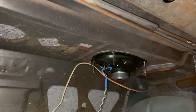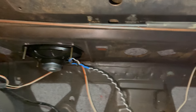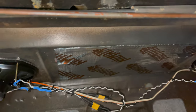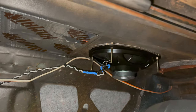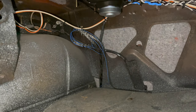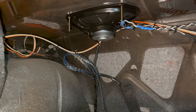Now that the speakers are all installed in the back, I'm just going to put a little sound deadening against that rear deck to give it a bit of extra noise reduction, then tidy up the wires and get everything zip-tied up. I put one sheet of sound deadening on there — there's not too much power or extreme sound quality here. Wires are all tidied up, RCA cables are tucked away in case there's ever a need for a sub, and everything's done back here.